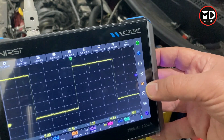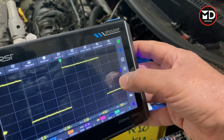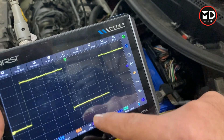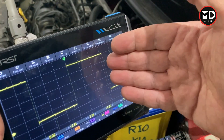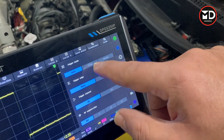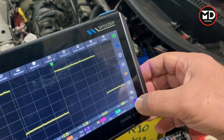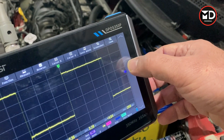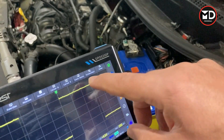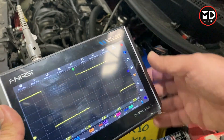If you want to adjust manually, you can adjust the voltage from this control and the time from that one. Using the voltage control you can have a shorter or taller waveform, and using the time control you can adjust to show more or fewer waveform cycles — this gives a really good view. For the trigger, you can use this section to select auto, single, or normal mode, and rising edge or falling edge between channel one and channel two. You can also adjust the trigger level from here. I'll make videos about all of these settings later on.